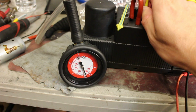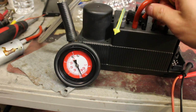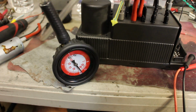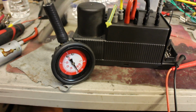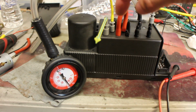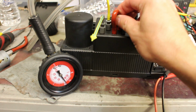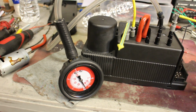So that's basically the locking and unlocking. Now the reason I'm showing it on the trunk circuit, I'll show you on the other circuits, on the door lock circuits. These manifolds switch over. First you get pressure vacuum on 2, and 2, it's like the pressure and vacuum just jumps between the outputs. So the trunk is always there, so I use the trunk for that matter.